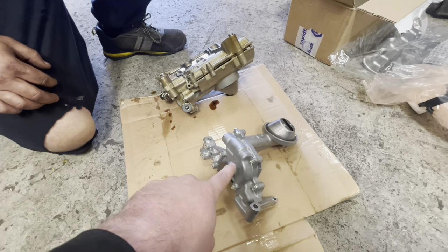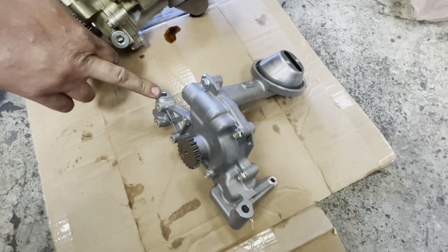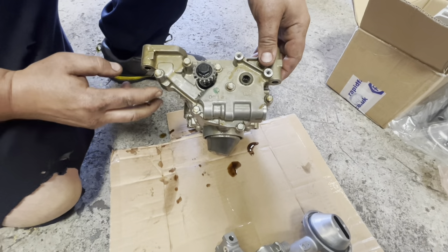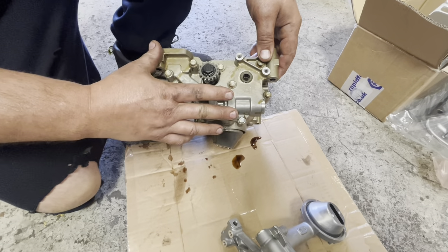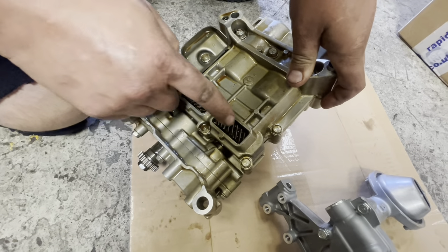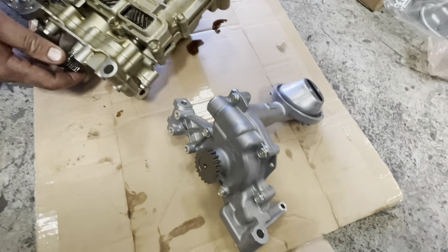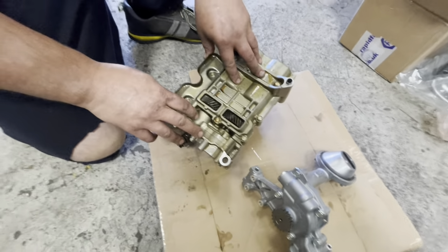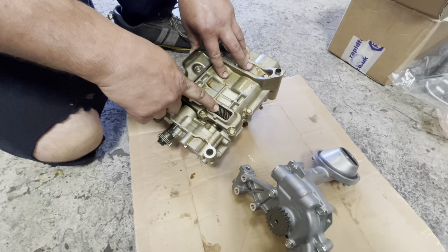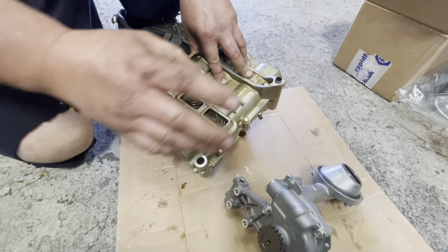Okay so what we've got here — this is the new part. This is the FD2 oil pump, maybe like an EP3-style oil pump as well, or very very similar to that. And this is obviously the original. You can see the size differences there. Yeah, this is the oil pump but obviously what this has is the balance shaft in it. So you've got the oil pump shaft which is this shaft which is driven, and then this is your balance shaft. So when they're talking about deleting the balance shaft that's what they're talking about. Whilst it's all one assembly it's doing that, and you're not driving that second shaft — that creates drag and therefore costs power.